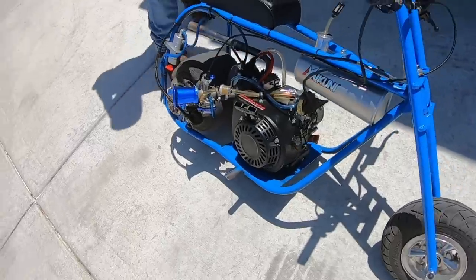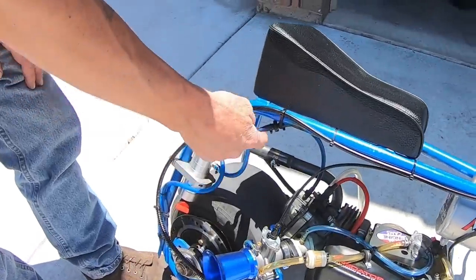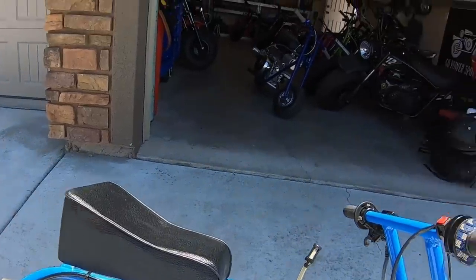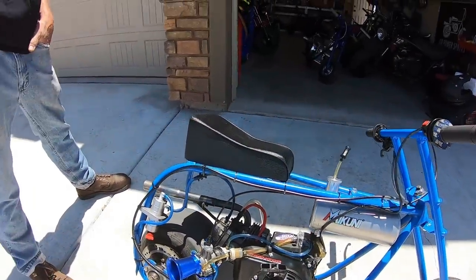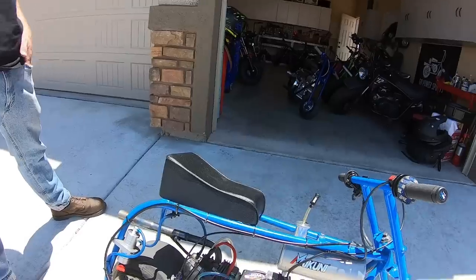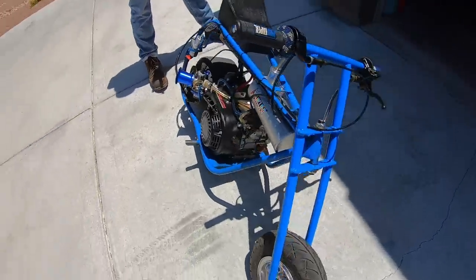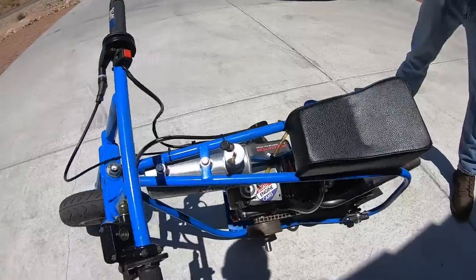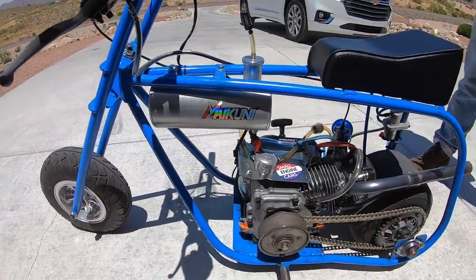One thing a lot of people don't know is about running the check valve in line with your catch can. Actually, I did on that. What that does is it allows for that crankcase pressure, but it doesn't allow for air to go back in the engine. I talked about that on that video, on that GTS bike. It keeps it from getting extra pressure in the crankcase, and it makes them leak less, and it also helps the ring seal.